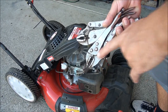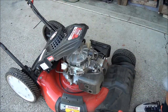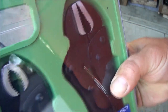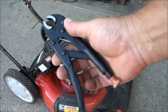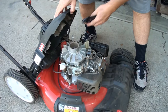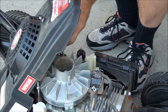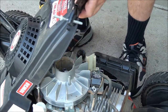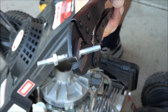What you want to get is a pair of vice grips with some good sharp teeth. My vice grips are pretty much worn out. Thankfully my buddies at Grip Tools sent me these — I'm pretty stoked to open this because look at those teeth. We're going to be able to get a good grip on this stud and pull it out. GRIP TOOLS: tools that mean business. You don't want to grip it at the threads of course, but you can get it up in there. There we go — and there's our pesky stud. It looks like if you have a long 10 millimeter socket you can hook onto this and not have to use the channel locks.